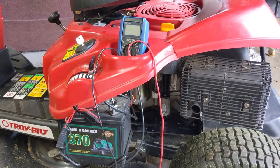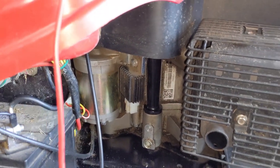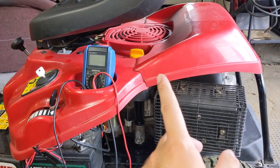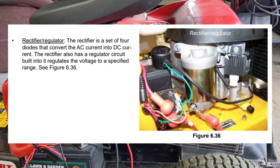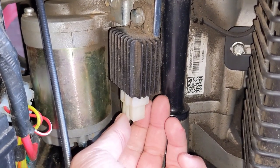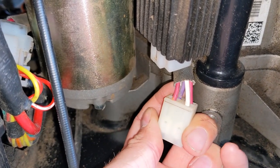At this point, I'm going to take you through a quick and simple procedure to identify whether we have a bad alternator or a bad voltage regulator — that black box right there. Essentially, the flywheel spins, the alternator sends down electrical current to charge the battery. However, the voltage the alternator creates needs to be regulated to a specific amount — on a lot of riding lawnmowers it could be 14, 15, or 16 volts — to ensure the battery is not being overcharged. That is the job of the voltage rectifier or regulator. We're going to come down to the connector, wiggle it, and unplug it. On the back of this connector you'll see a purple wire and a red wire, and on the other side a red wire and a white wire.